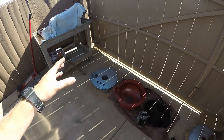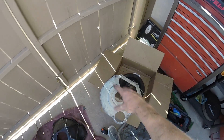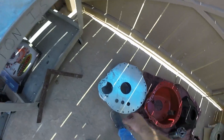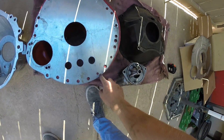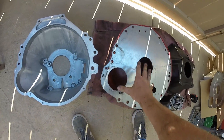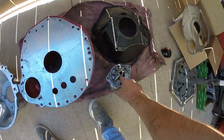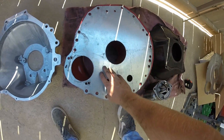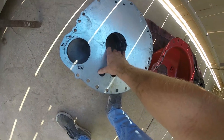Picking this video back up — I think we were just putting the flywheel on and the motor backing plate, that's all we really got done. We stopped because we were pretty much done for the day, but then I went and put everything on and nothing seemed to line up properly. There's a difference between the flywheel and backing plate I have versus the new flywheel under the truck. This scatter shield has a ton of holes in it to line everything up — multiple starter holes — so I was worried this wouldn't fit, and the biggest issue was getting the starter to properly engage with the flywheel.